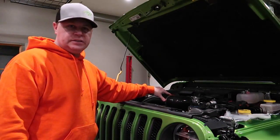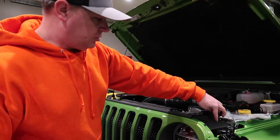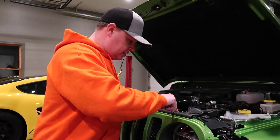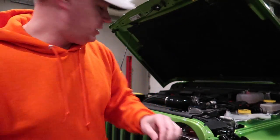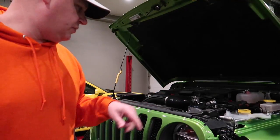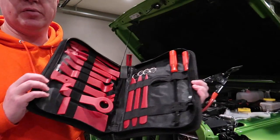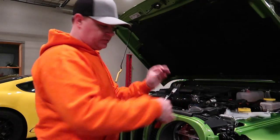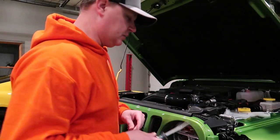As you probably saw in our last Flowmaster cold air intake install video, it's really easy to remove this grill. All you really need is a flathead screwdriver. There are six plastic tabs across the top of the grill — you just got to pop the head out. Once the head of the clip is out, you can pop out the actual tab sitting down in there. A flathead will do it, but it does help to have a trim removal kit from Amazon — super cheap. Pop the head out of all of them, then use that to pop them out the rest of the way.